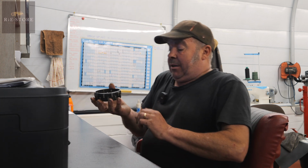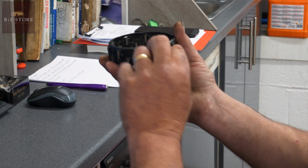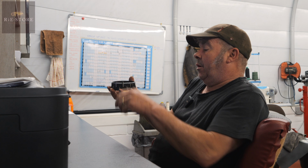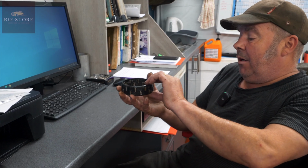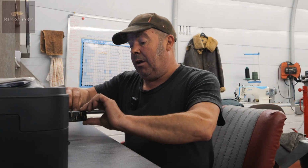Basically a standard Harley one, yeah? You have little ball bearings, 2 rows of, all the way around a column. I think there's like 40 in there or something. But these have staggered needle rollers, so it takes a lot more of the slack out than what you get with the ball bearings. Okay. Because obviously all the parts wear. It was never a good idea anyway, but it's just what they did in the day. But they definitely improve it a lot. Okay. Yeah. So yeah, recommend that.